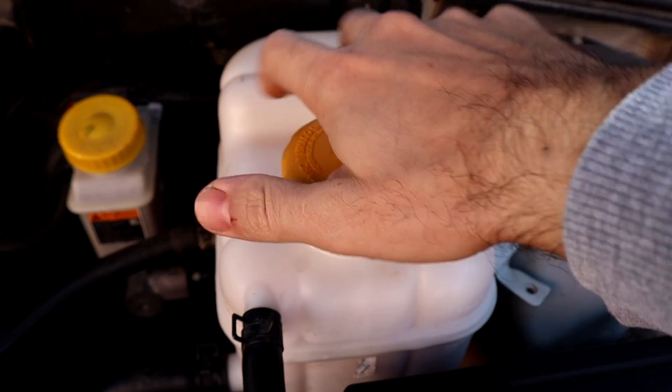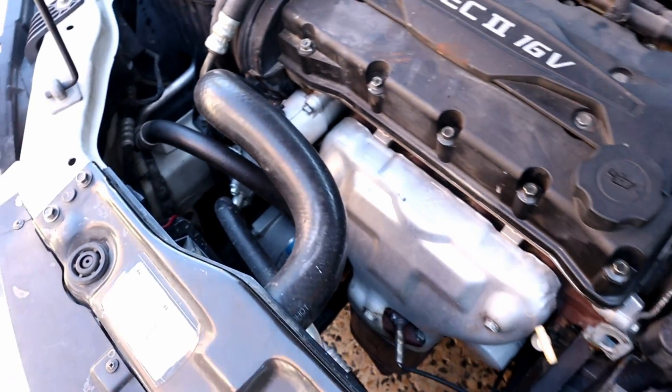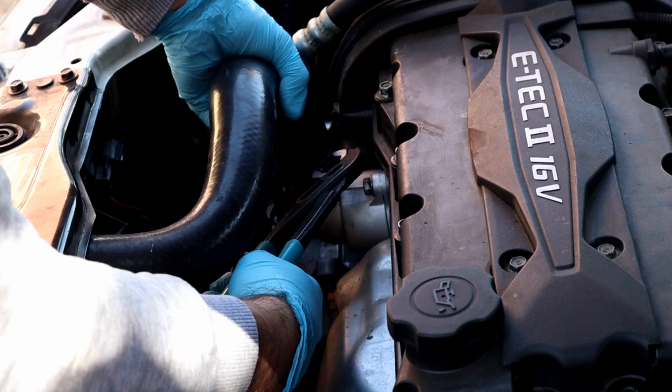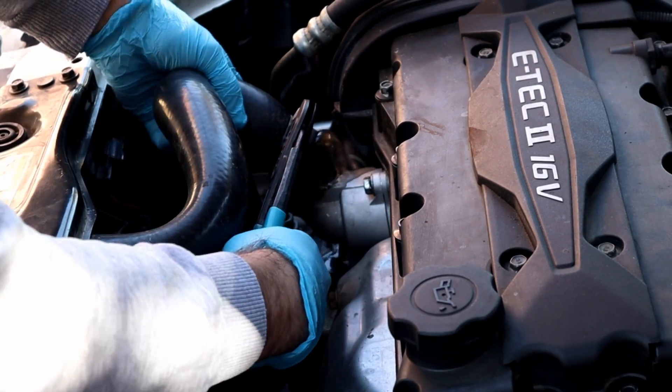Alright, it's been 3 days. Looks like the flush cleaner did its job and the distilled water changed color. I didn't expect the dirt to stick to the reservoir like that, but it's an easy cleaning — I'll show you in a minute. Let's remove the hoses and flush with distilled water again like we did before. Pretty much it's gonna be the same process again.